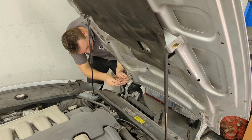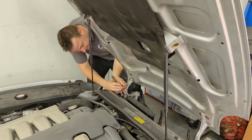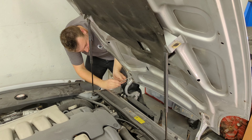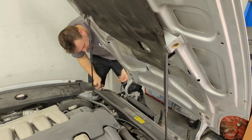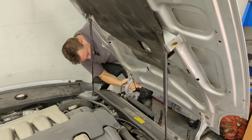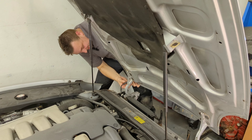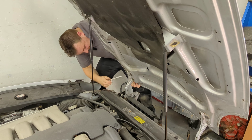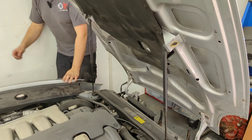I've cracked all the bolts off and I'm just going to have them loose but not fully undone. I can move the bonnet up and down, then slightly tighten one of them up, put the bonnet down and see what it looks like.